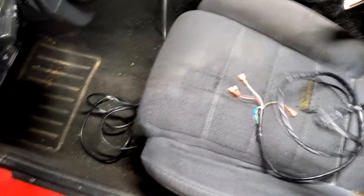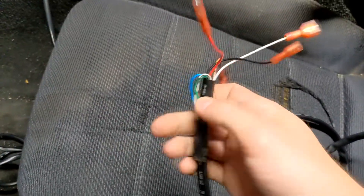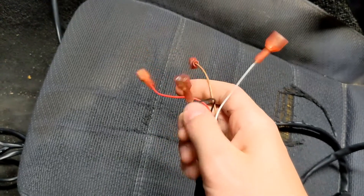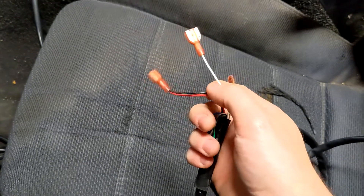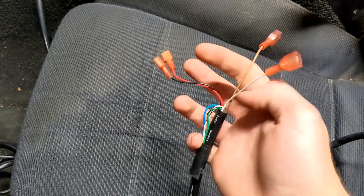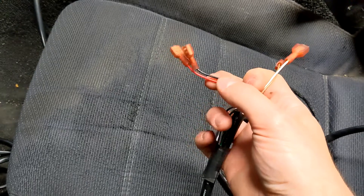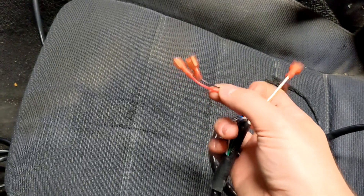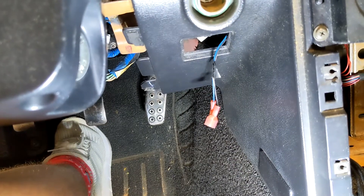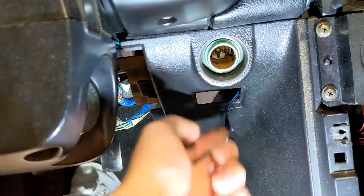Now for the power and output, you have what I'm going to call the Medusa plug — all these wires sticking out of the end. I've taped these back because you only need four. You have your black and your red, which is obviously power and ground, and then this is your output to your ECU. I'll show you how to wire those, but first we need to get power to the gauge. The easiest way, in my opinion, is your cigarette outlet — I have this light out because it's easier to reach up in there.